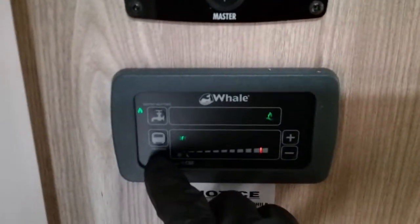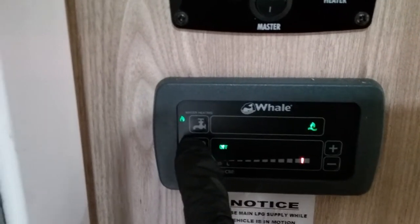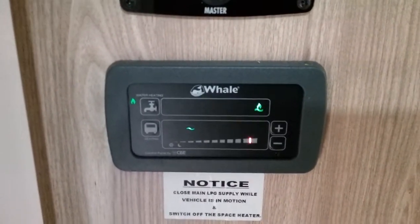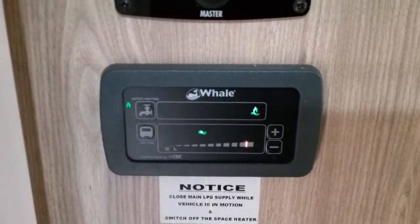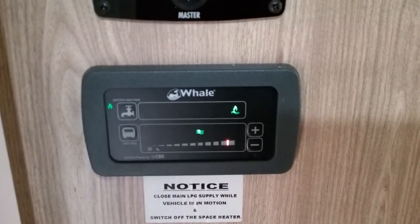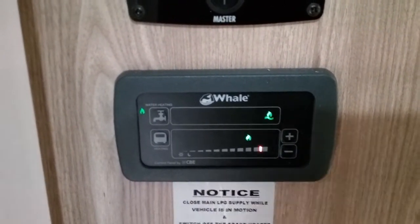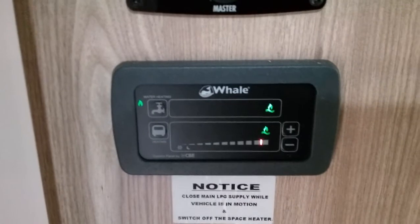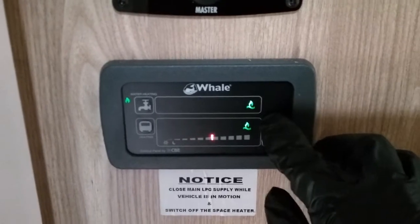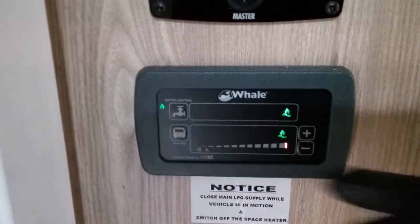If we now go to the heating, again you will see as I press, it will go over the series of icons until eventually ending back at off. First icon, wavy line, so yes, mains electricity again, but this time at about 500 watts. Then we have mains supply at 1 kilowatt, and then mains supply again at 2 kilowatts. We then go over to gas only, and then we have the dual fuel mode again. Temperature setting on the plus and minus just here. And again, whenever the heating is consuming gas, you will get a flame icon just appear here.